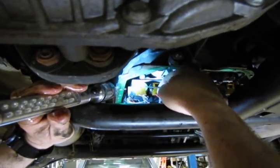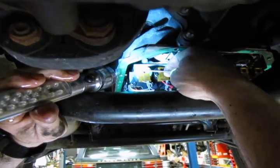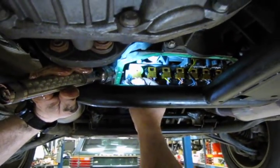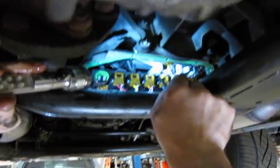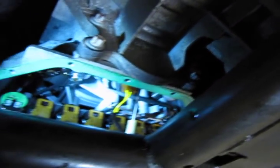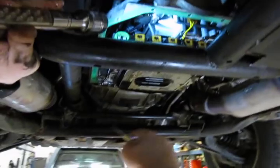So to disconnect the solenoids, you take a small flat blade screwdriver — a little pocket screwdriver comes in handy or anything with a small flat blade. Get in behind the tab, you can lift that out. Don't worry about breaking it because you're replacing it anyway. Pull that out and you're going to do the rest of the solenoids the same way. Then when you want to disconnect the two sensors, there's one bolt that holds a retainer flat in place — you're going to drop that out and then that connector will come right out, and you'll have one in the back and one in the front.